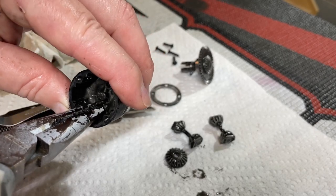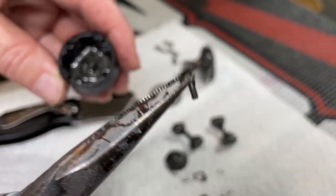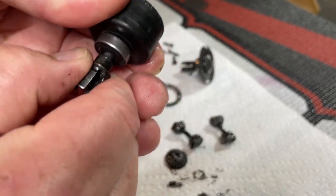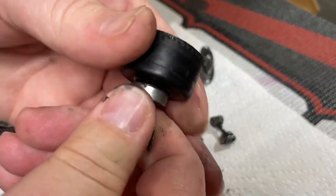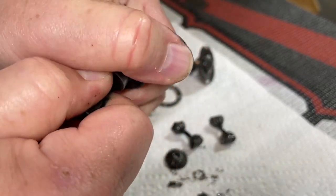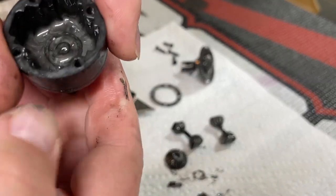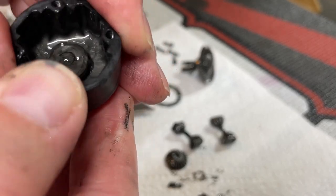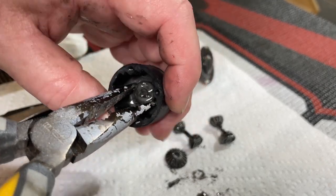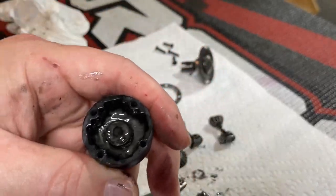With the sun gear out, underneath there is another pin. That pin came right out, and now once that pin is out your out-drive cup should slide out a lot easier — unless it's all chewed up and bound up, which mine kind of feels like it is. Mine's a bit bound up — I think I might have some wear on the inside from that pin hitting against it.